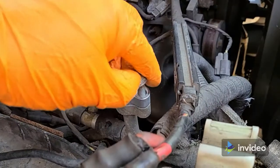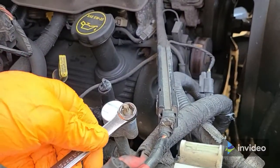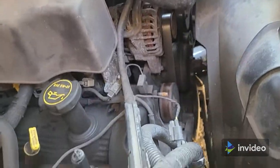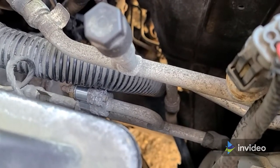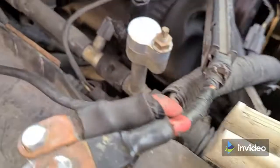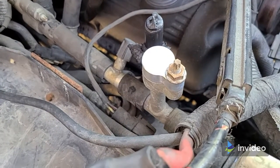She's still got a small leak somewhere, so I poured about 50cc of oil into the suction port. I'm going to cap it off and evacuate for a long time — I'll leave the vacuum pump running for a good long time. Then I'm going to charge it to just a little bit over the sticker amount for a front-only system, because I've capped the liquid line with about 10 centimeters between the T and the block-off cap. Some extra refrigerant liquid will be in that short section, and the suction line will be almost zero since it's vapor.